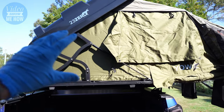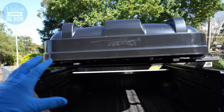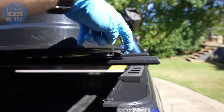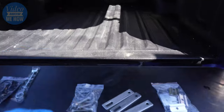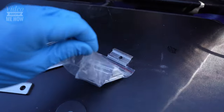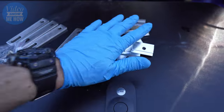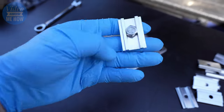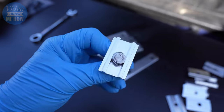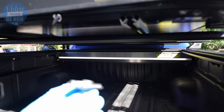From here, reverse the process to fold the tent back down and pack it away. Once back in position, we're happy with final placement — measured on either side to make sure we're square, enough clearance with the awning, all good. Now let's get it bolted down. You'll need your load spreaders — one per corner — they slot into the channel so it's not just the bolt head providing strength; you're spreading that load across the whole channel.